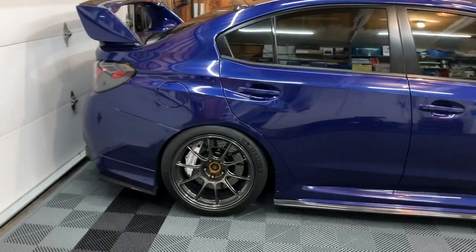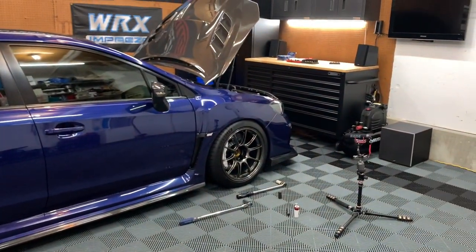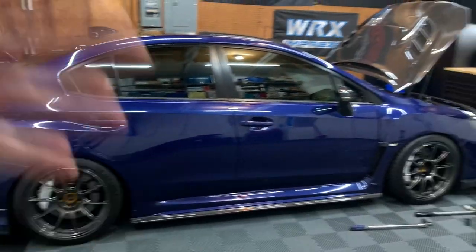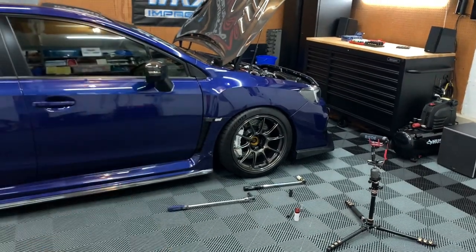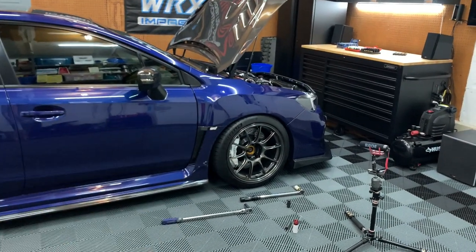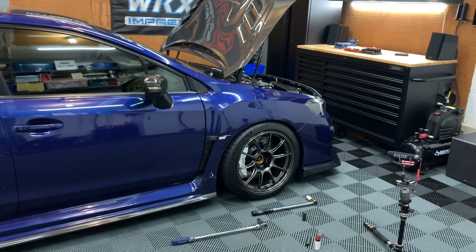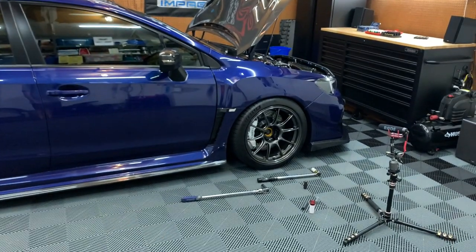But obviously you guys don't need to see me do the entire car. You get the idea. It's pretty straightforward, just changing out lug nuts. Now, a lot of people are going to say you should jack up the car, but I do it this way all the time, anytime I'm changing lug nuts, simply because the wheel's actually sitting on the hub of the car, the lug nuts just hold it on. And the wheel's already centered on the hub with the hub-centric ring and obviously being torqued down prior. So it goes straight on.